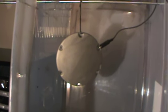So these holes probably should be filled, but they're not threaded, so I'm not too worried about it. Normally you'd want to fill any holes, especially threaded holes, with either special high heat plugs, or I like to use aluminum foil. Roll up a piece of that and stick it in the hole, and that prevents it from clogging up. You don't want to powder coat with the screws in there either. The screws can kind of act as a bridge, and the powder can stick to the screw and the surface you're powder coating, and it can get stuck in there pretty good and follow up the threads.